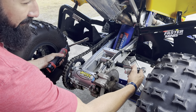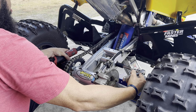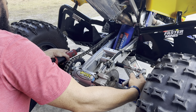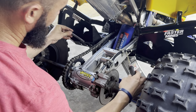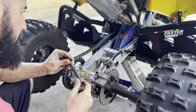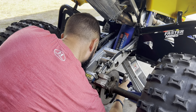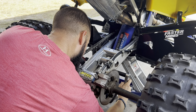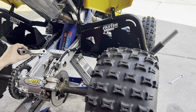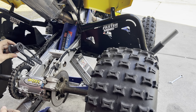I ended up breaking this free using a breaker bar with a 17mm and extension, and a 14mm with an extension on this side. Just had to tap it with a hammer — it was locked in there pretty good — gave it a little tap and it came right out. Should be able to throw the new link in. I think it goes like this — I don't think it matters which orientation.